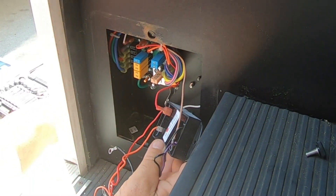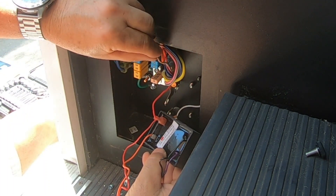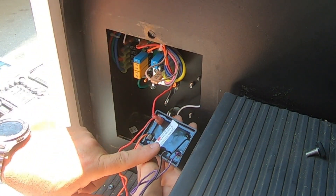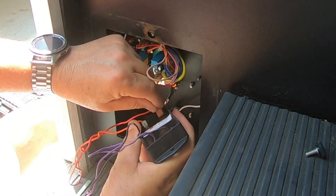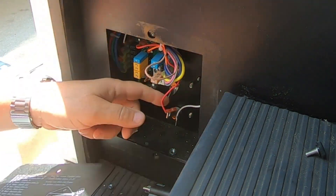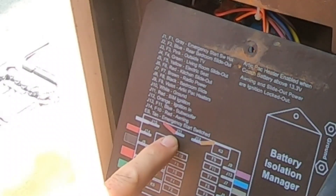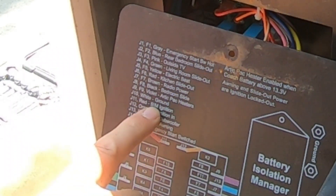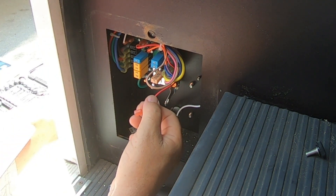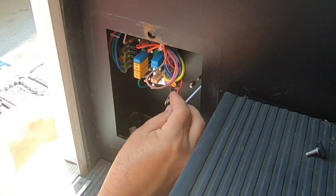I've got the BIM off the RV. The brown wire goes to the emergency start switch. The only wire that connects from the RV to this BIM is this red wire — the ignition wire — it's just a spade connector. I know it's the ignition wire because if I look at the schematic on the back of this cover plate, it says J11 red, J11 red BIM ignition. So I know this wire goes to the ignition on the new Precision Circuits BIM.